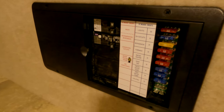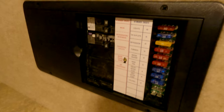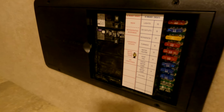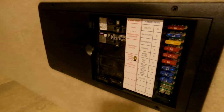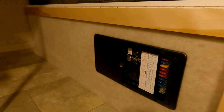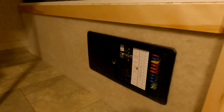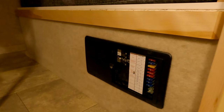Over here is your fuse panel. You have 10s, 20s, and 15s for 12 volts, and you do have breakers. The way the 2023 trailers are made is they have breakers for everything — wires for all the features. So if later on down the road you want an AC unit, we can add one because it's already wired for one, and it holds the value better if you ever want to sell.